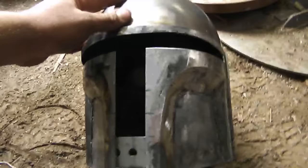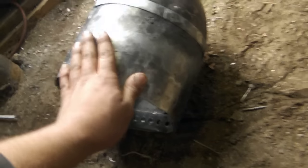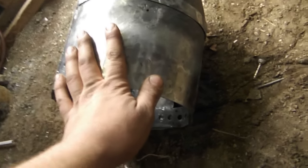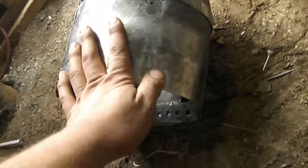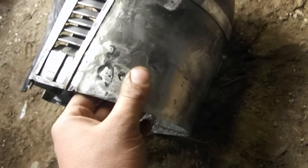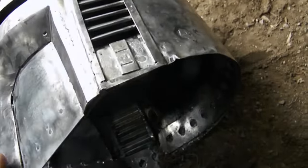So it's all steel. The rear panel is 20 gauge — I'm changing those back up to 18. It saves maybe half a pound, but it's a lot more difficulty than it's worth, as I kept blowing through it with the MIG. Some areas I went through, but filler weld, you know, it's fine. Just a bit of JB weld.